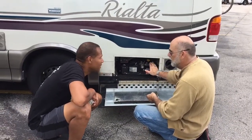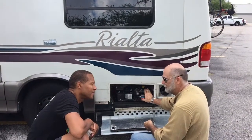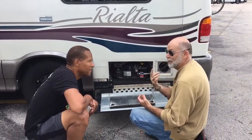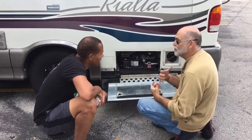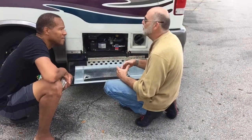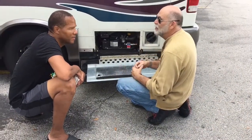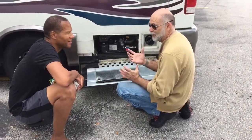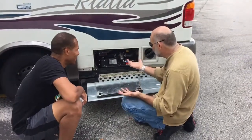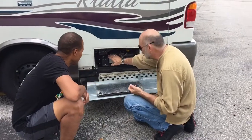It started, and then it went dead. It wouldn't start again. So we pulled it off again, pulled off the rotor, and all the magnets were loose. Oh my God. So I took the magnets off, looked some things up on YouTube, and ended up gluing all the magnets back on with JB Weld, and put it on, and it was running like a top until this happened again, and there was the starter.